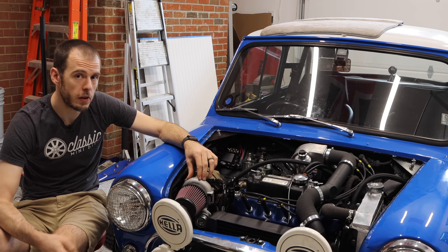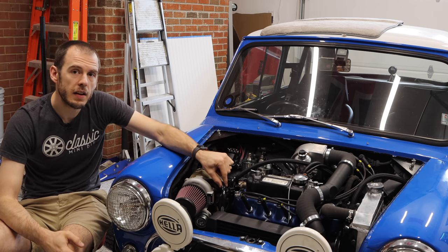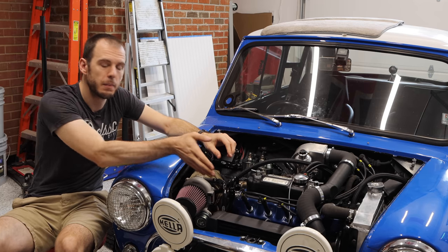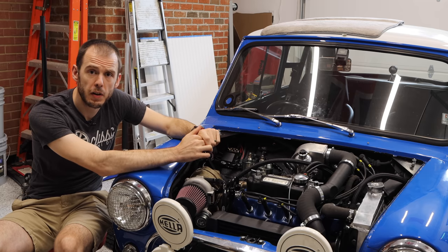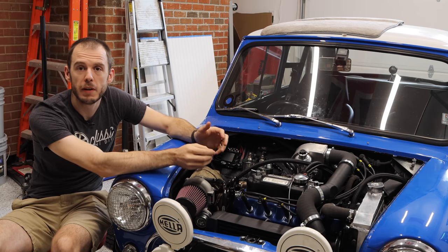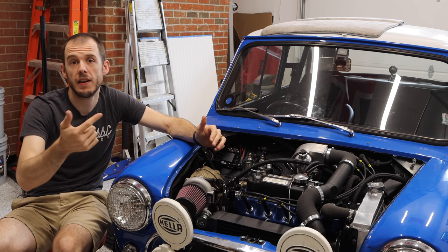This turbo is also oil-fed, which means that it needs lubrication in order to keep that turbine lubricated and from having any sort of damage caused to it. The turbo line is pressurized on the top side into a banjo fitting in the turbo. That goes through, lubricates, and then it is gravity-driven and out the bottom of the turbo into the block where the old distributor used to be. During the B-roll a little bit ago, you probably saw me screwing in that 10AN fitting directly into the block. That is the turbo oil drain. And then right above that is the turbo oil feed, which is coming off the same takeoff which was previously used for your oil pressure light switch or an oil pressure gauge.